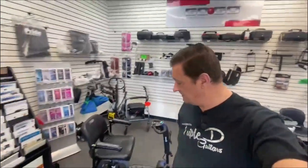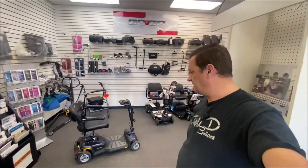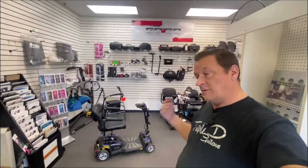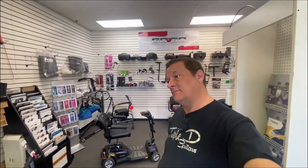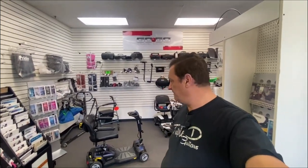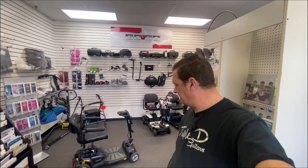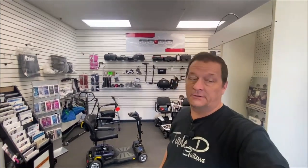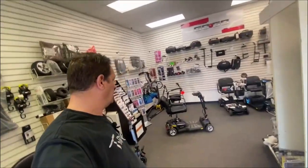But anyway, hope that you found this video interesting. How you go about diagnosing something that's intermittent, especially those intermittent faults that are difficult to figure out. But go methodically through it. Test things that you may not think of, like sand in the battery connector. Who'd have thunk it? But hopefully that's cured it. If not, if it's something else, then you're looking at the controller or transaxle, but it seems to be fine now. I think it was just a bit of sand in the connections, but I don't know.